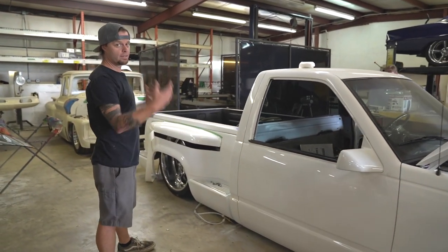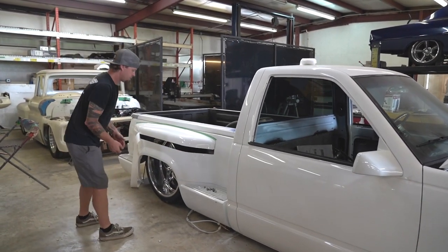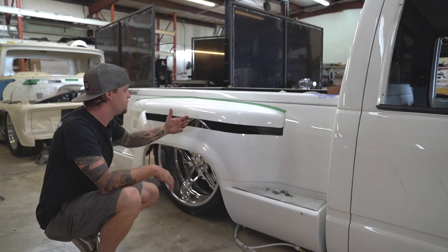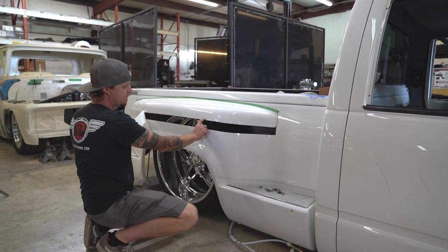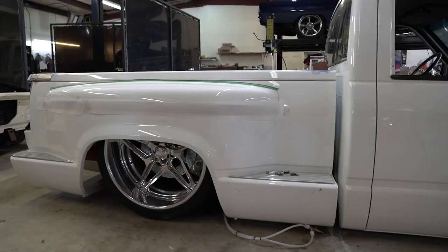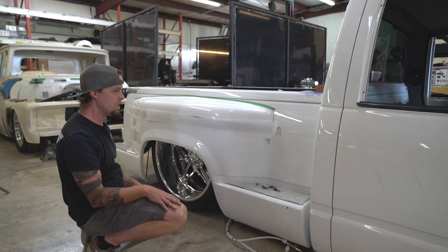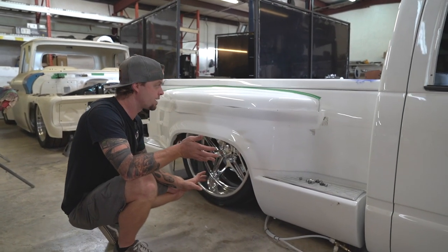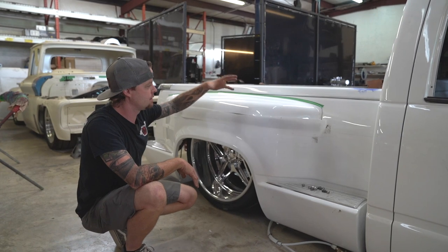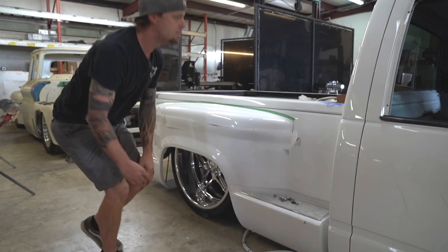This is probably one of our favorite builds around here — we love getting them on the ground, big wheels, a lot of power, and the cool custom paint this thing's going to get. Right now we've been making clearance for the rear wheels. We cut the fiberglass out — we wanted a step-side, not a fleet-side, so there's a lot of modification involved. You can see how much we've raised it; just by this white piece of paper you can get a good visual for what it's going to look like. This is a two-to-three-year build, so we'll drop updates as we get sections done.